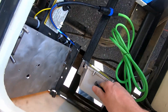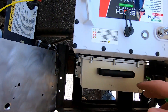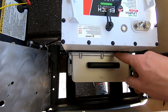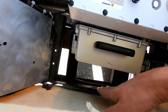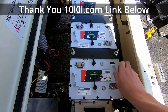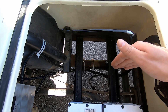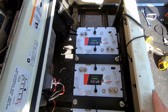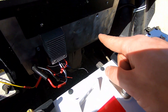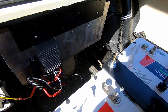As you can see, there's no way that's coming out of there now. So that's the charger mounted. Now I'm going to put the batteries in and strap them down. I've got a nice gap here between the batteries and the charger, and this is the back of the charger so it doesn't heat up very much. The heat sink's on the front. I have a gap here for airflow, and I have my batteries mounted in. With these two straps, these batteries are not going anywhere. Look at all the room over here — I could almost fit another battery, maybe two, if I was to shift this down. Wiring is going to be next. I think I'm going to mount the bus bar up here.